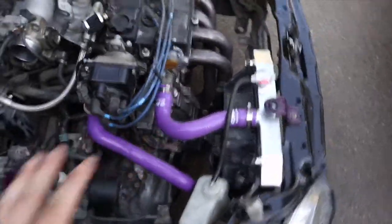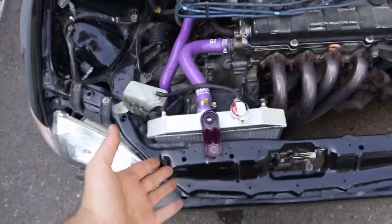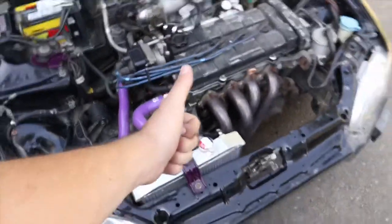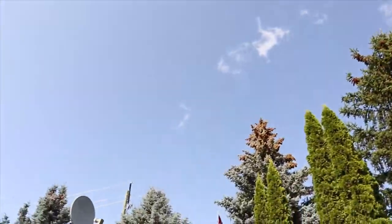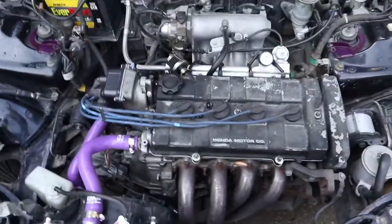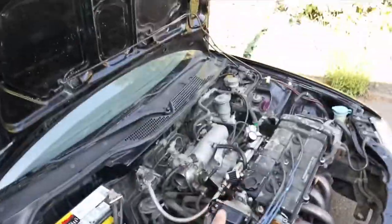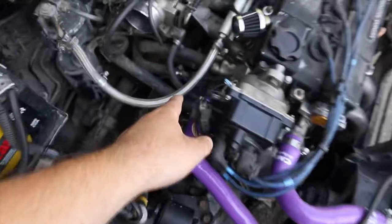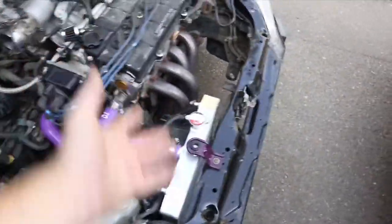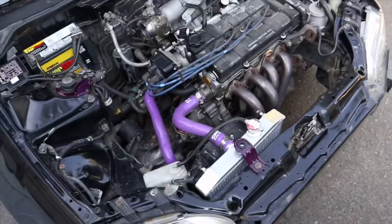It shakes a little bit and that's dangling, but as far as the cooling system goes, this is the civic's new setup: aluminum dual core, nice hoses, new sensors and thermostat — she's ready to stay cool in this hot weather. I'm not sure what's going on with the gauge inside though. I thought that sensor under the distributor would fix it based on everything I saw online. I also have a brand new sensor that goes in the thermostat housing, but that controls the fan and I'm wiring that to a switch so I have full control.